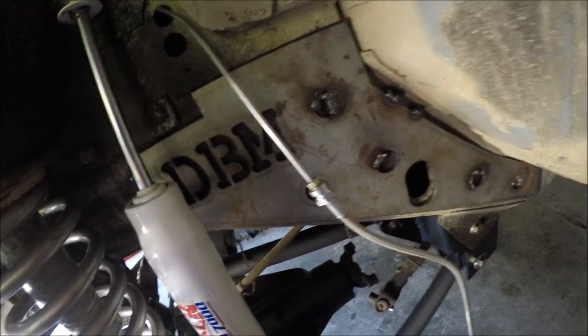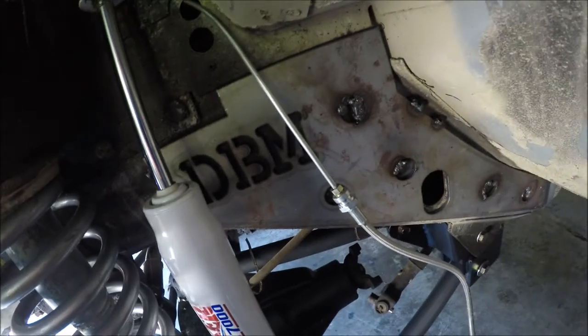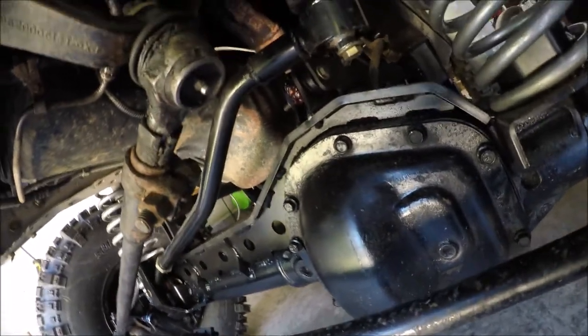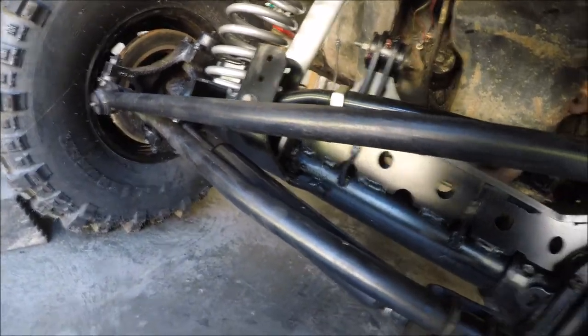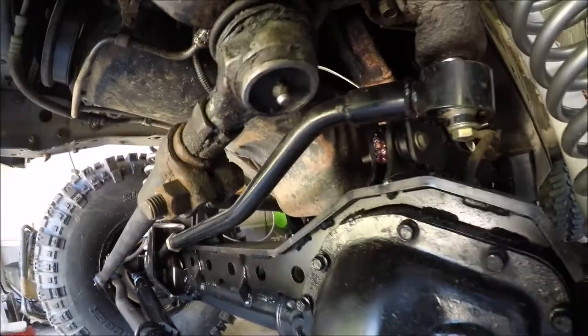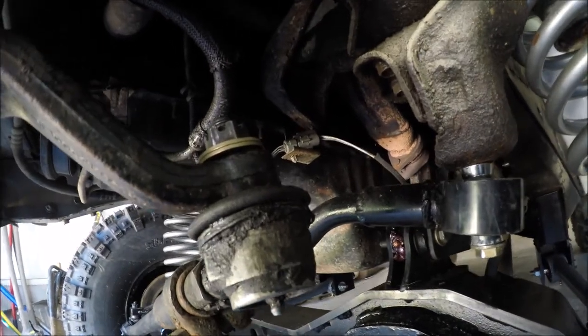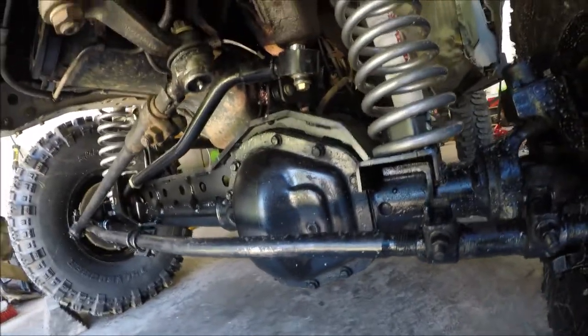After I get the frame stiffener welded on, I need to weld a little bracket so I can hold my brake line back so it isn't just hanging there. With this kit it made it basically a direct bolt-up. The only thing I really had to do was shorten the track bar just a little bit — that's just because of the way these mounts are, but it was no big deal, I shortened it about three inches. And this is the factory Jeep pitman arm — I did have to drill that out just a little bit to get that bolt on there. Other than that, this is basically a direct bolt-up with this Artec kit.